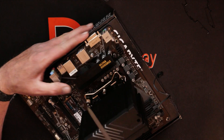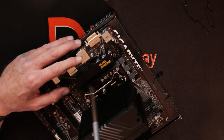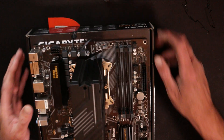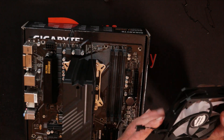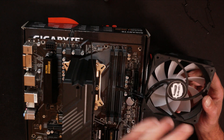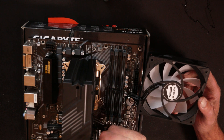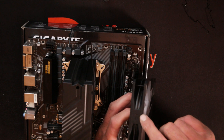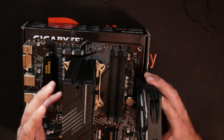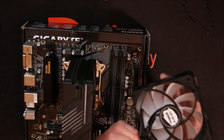That one's down there pretty good. Finish snugging that one down. The screws should bottom out — you want them about this tight with a regular size screwdriver. You don't need to really over-tighten. Now we're going to put the fan back on. You want these brackets facing towards the heat sink — the way it came off. There's actually a little arrow right on top that shows you which way the airflow goes. Most people have them in a push configuration where the fan pushes the air through the heat sink.